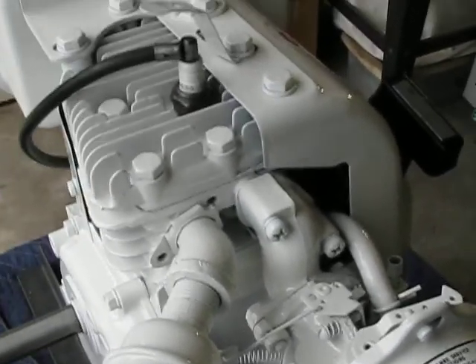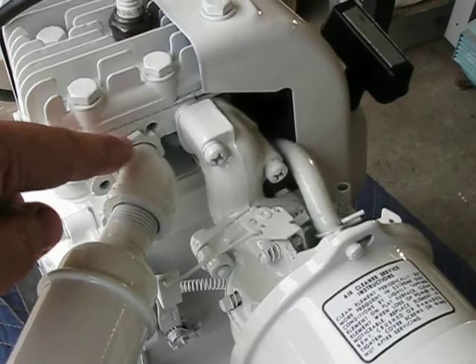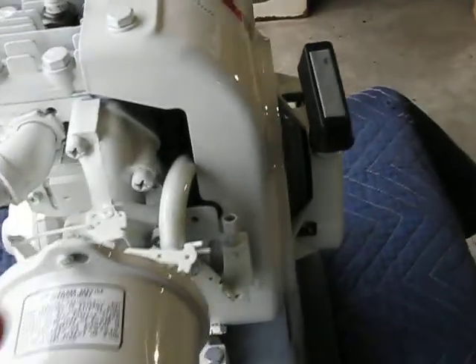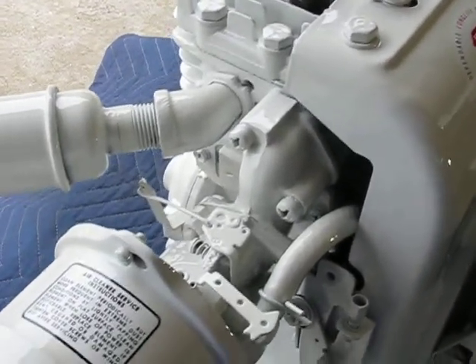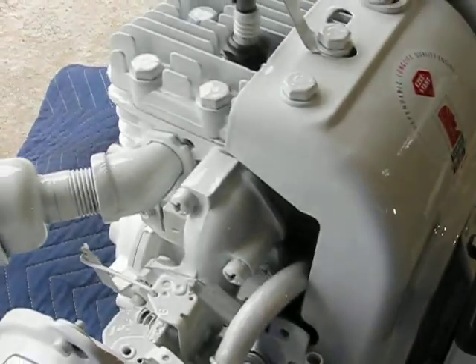Light transition porting in the ports — you don't want to go too big on something like this, it's kind of a waste. The exhaust I do open up, and everything kind of flows better. Match ported on all the surfaces so there are no walls in there or anything that causes disturbances.